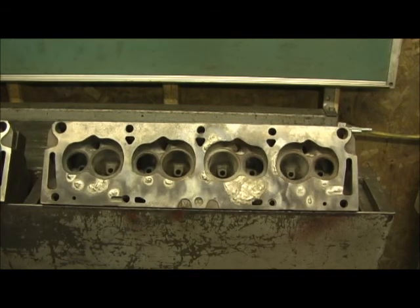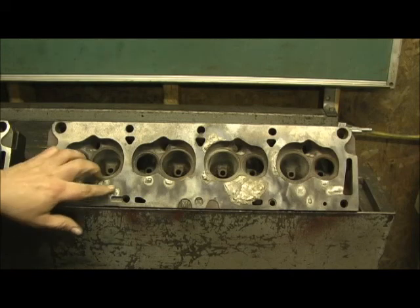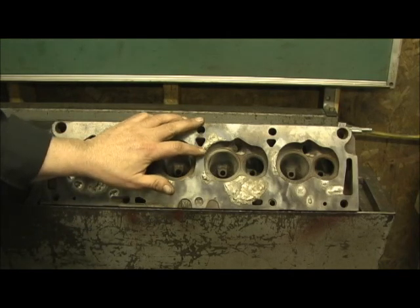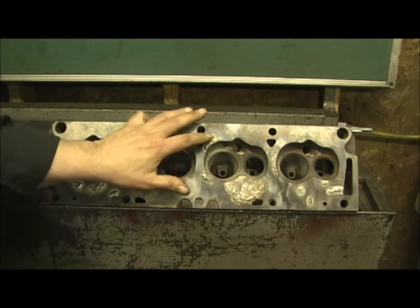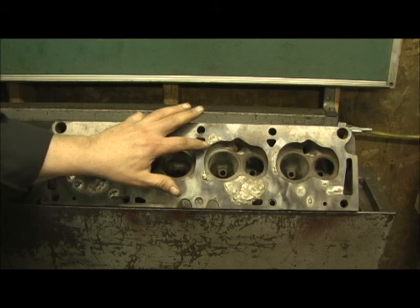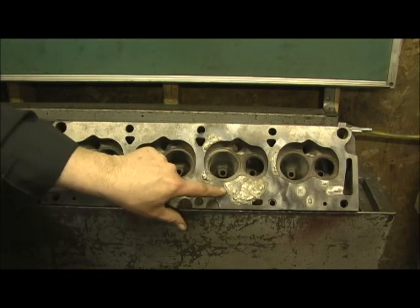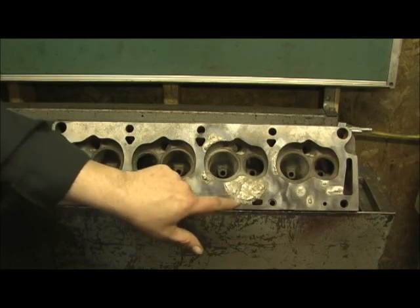As you can see, out of the oven and wire brushed — see what I'm up against here. What I've got to do is very carefully go in here with a die grinder and knock the top off and try to lightly get it to break the edges where they're flush to where the nickel becomes part of it.